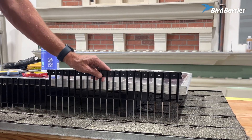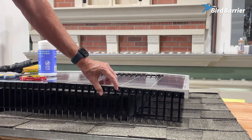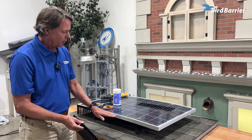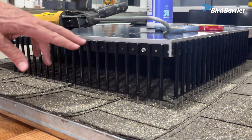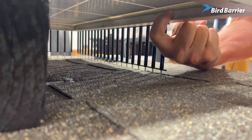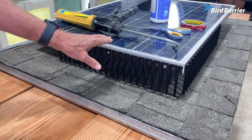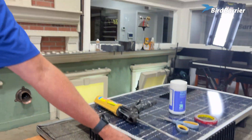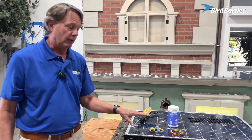The way that works is you would just put it on, lower it down, and when it gets flush with the panel, that's where you want to secure it. Securing it to the solar panel is something that really needs to be discussed because you don't want to put holes in here with screws. We ran three self-tapping screws through here just to show how that could work — there is an open channel on the back. But many solar panel manufacturers might void the warranty if you put screw holes into their materials. We really recommend using screws only as a last resort and only if you have written permission from the building owner or homeowner or somebody taking responsibility if there's ever a problem.